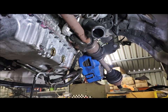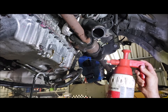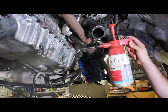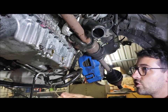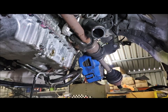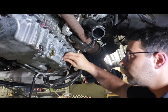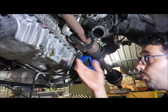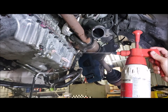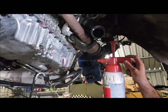Clean all the oil off with some brake cleaner and get them completely dry — just going to leave that to drip. Once that's nearly finished, grab some brake cleaner and clean all the oil residue off. Because with an O-ring, just like a gasket, if there's any oil residue, it will not seal properly and it will just carry on leaking. Any brake cleaner you spray up at this angle is just going to run back down, which actually helps the oil run out. You can rip off a piece of rag, making sure there's no long bits, and shove it in the hole so any dripping oil gets absorbed. Then clean off where the O-rings are going to sit. You know there's no oil left when the brake cleaner looks clear, just like water.